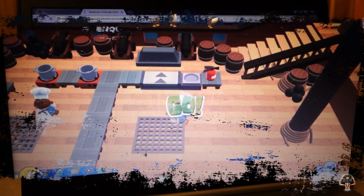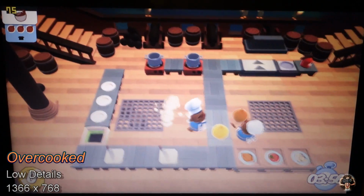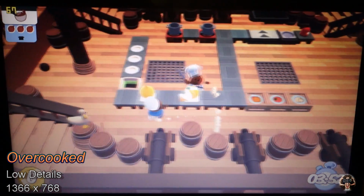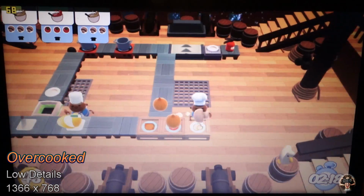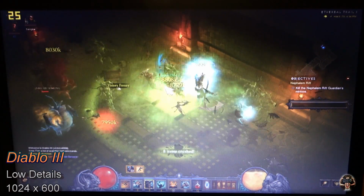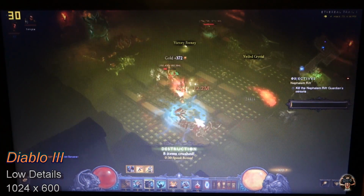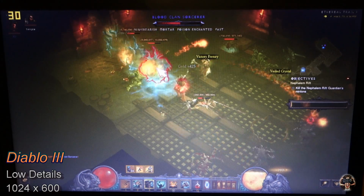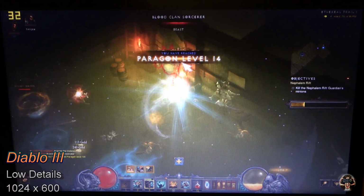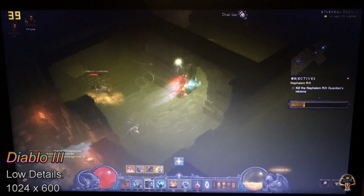On to gaming. Let's be honest, the only reason to get one of these HP EliteBooks is they're cheap and have a dedicated GPU with GDDR5 VRAM. That being said, let's still do a reality check. This Radeon 7570 is 4 years old, and even when it came out, it was just under mainstream power. The fact that the display runs at 720p at the most is the saving grace, and the only reason why this is a viable gaming device.